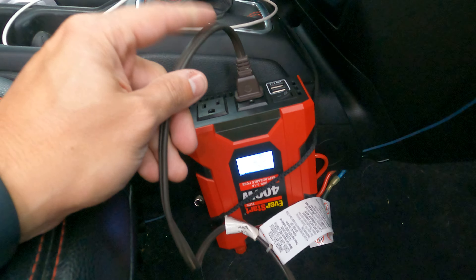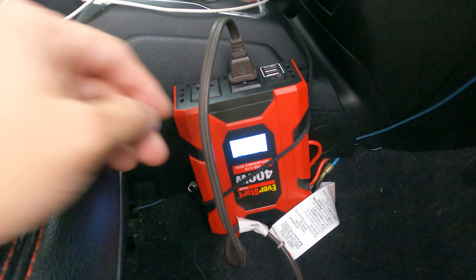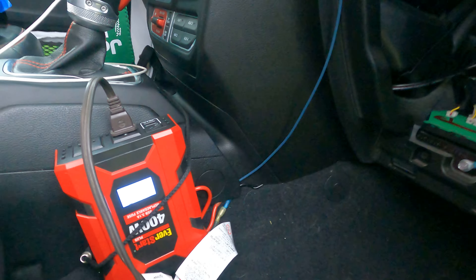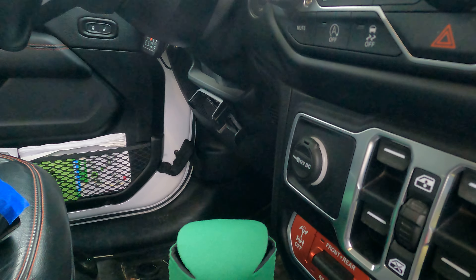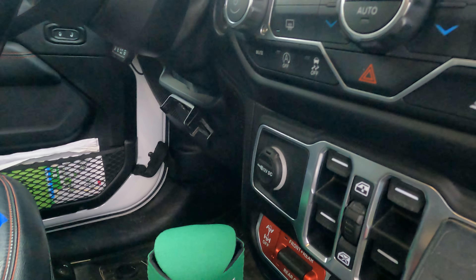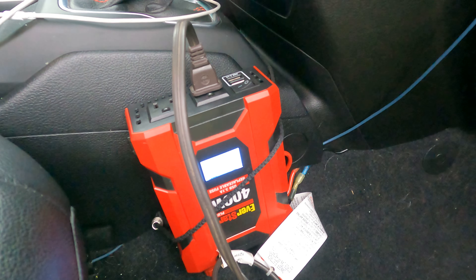This is the extension cord that goes from inside my Jeep to outside my Jeep. I wired this directly to the battery with a fuse in between. I have some fuses back here for different circuits that go straight to the battery. It's not required — it's just what I do because my Gladiator only has this one cigarette lighter that unfortunately doesn't stay on after the ignition is turned off and when I open my door. If I want my lights to stay on beyond that, I can go ahead and use this sucker right here.